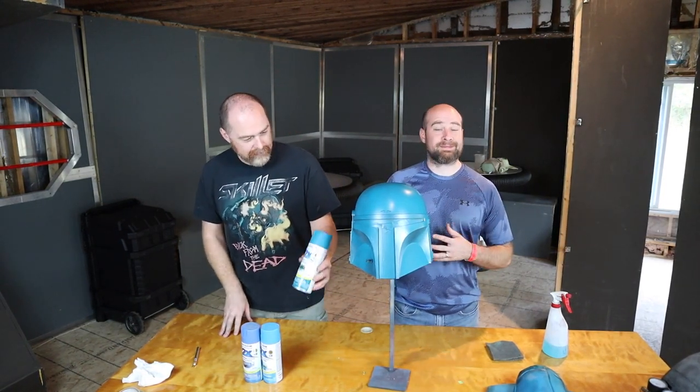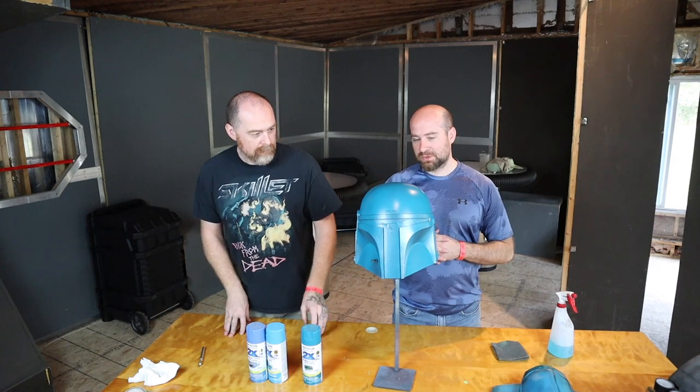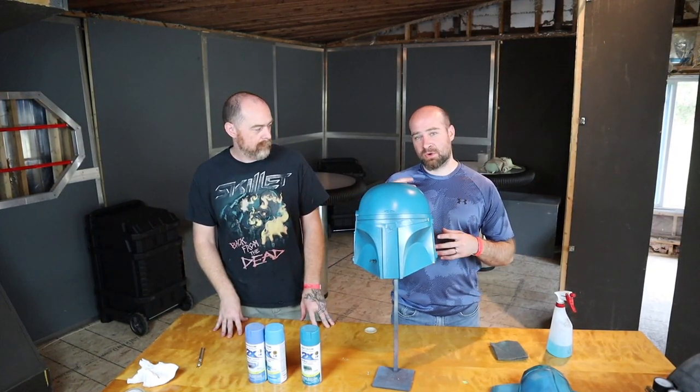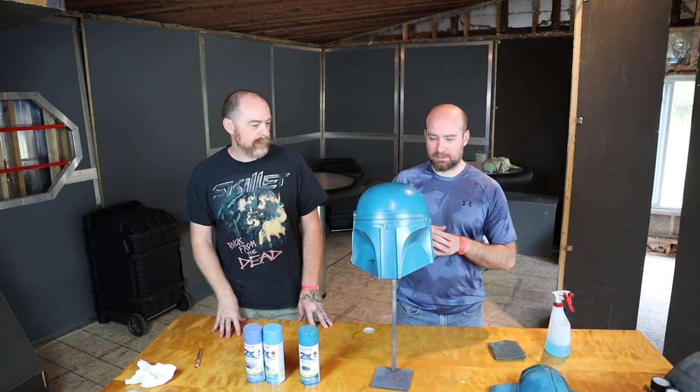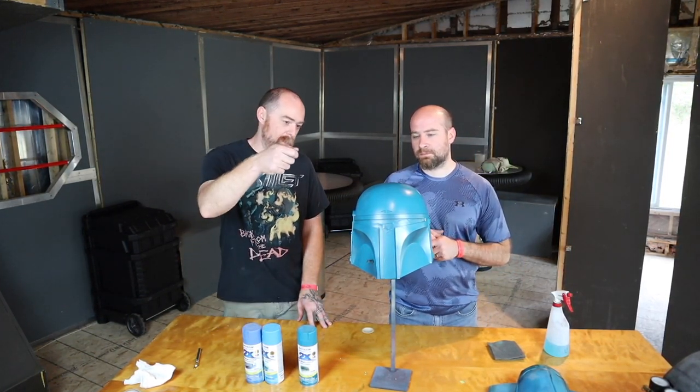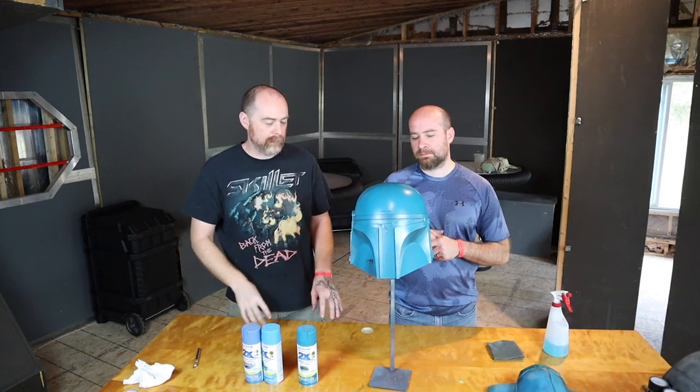Mike got the Satin Lagoon on. He's using a heat gun to flash it, so the process goes a little quicker. At least at this stage, I'm not sure you can do that later or not. When using a heat gun, don't ever leave it on one spot. You'll boil your paint and make it look all bubbly.